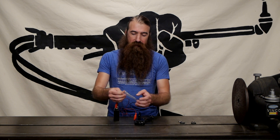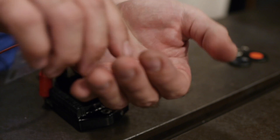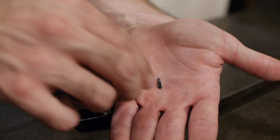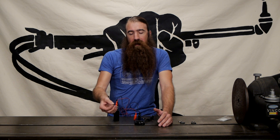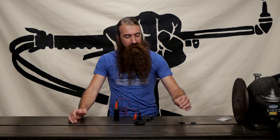That's the basics of how the M-Lock works, but here are a couple of things I don't like about this product. First, the way I ride, I don't like having to fish out my keys, turn on my bike, put them away, go for a ride, then fish them back out again to turn off my bike. But there's good news — there's a solution: a little optional glass tube RFID tag about the size of a grain of rice. You stitch it into a fingertip of a glove, a sleeve of a jacket, or even the end of your belt. Then you just wave your hand over the reader and like magic, your bike comes to life.